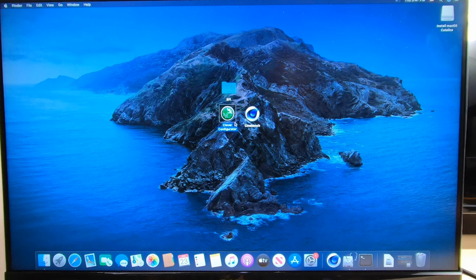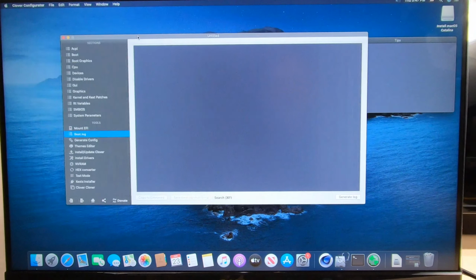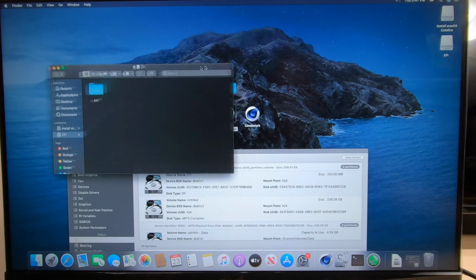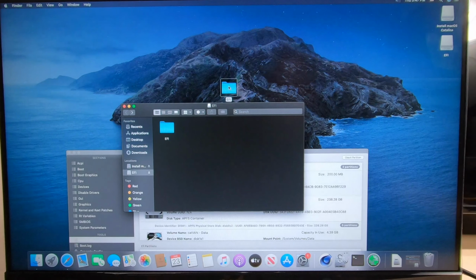Once we're done making the USB, we're gonna come over here to the Clover Configurator, and we're going to click Mount, and we're gonna mount the USB that we just made. Now yours is going to be empty. It's not going to have this EFI folder in it. So what you're going to do is download my EFI folder for this build from below, in the description, and you're going to put it on the drive and just click replace, and then that's it.